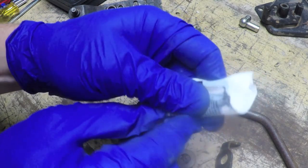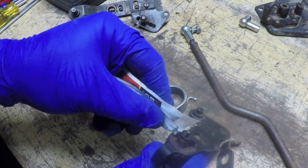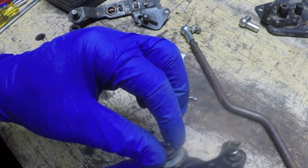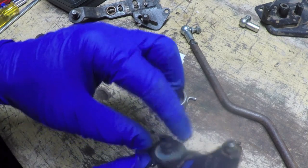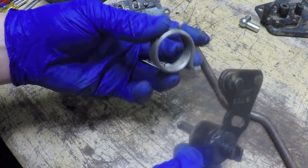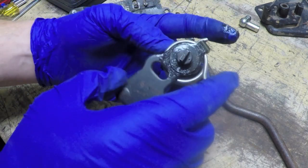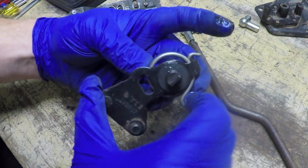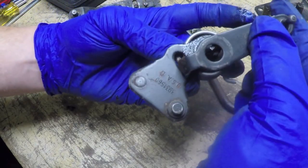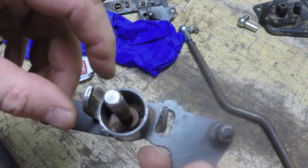I'm going to add some grease to the washer. The grease I'm using — because I happen to have it handy, left over from my last brake job — is brake and caliper grease. I figure it's probably not a bad choice, given the type of job it does in a braking system. It's probably high pressure, not made for high RPMs, because we're just talking about this thing basically pivoting back and forth. Now I reinstalled the plastic washer, then the bracket, then the metal washer, then the E-clip.